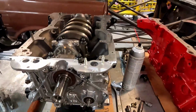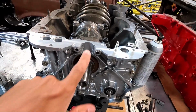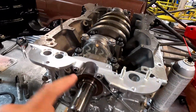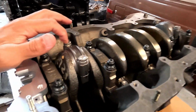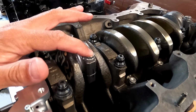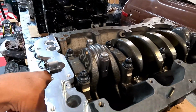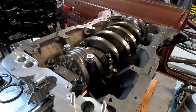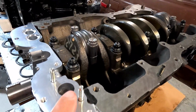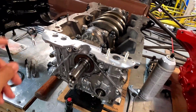This combination is going to use the Altezza oil pump, which is a very, very good oil pump. The crank timing sensor goes right here. This one has Carrillo HD rods with their CARR bolt, which is their upgraded bolt. Super strong rod. Man, we've pushed these rods upwards of 1,000, 1,100 horsepower without any issues. Great connecting rod. It's got a CP piston in it, and again, he's probably shooting for about 600, 650, like I said.